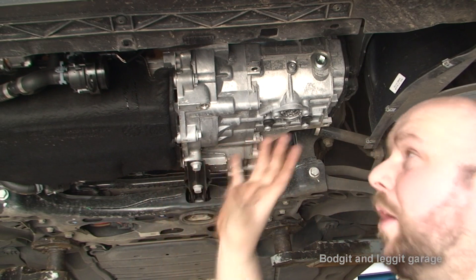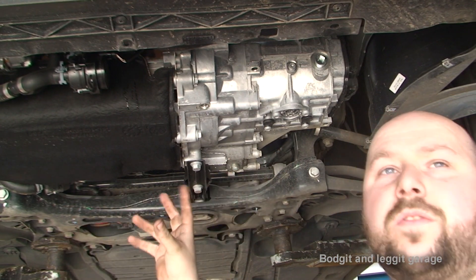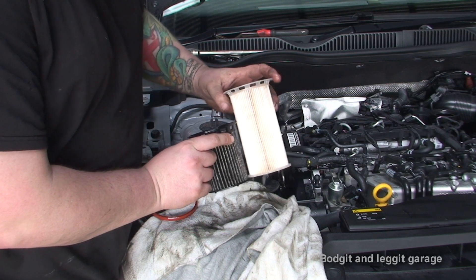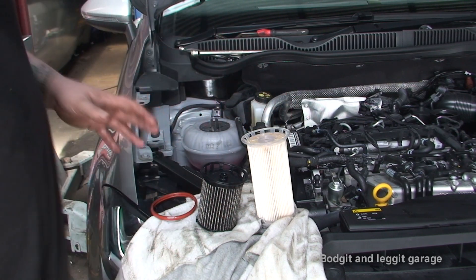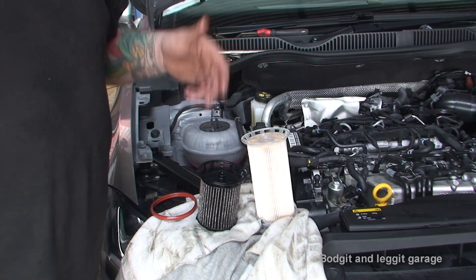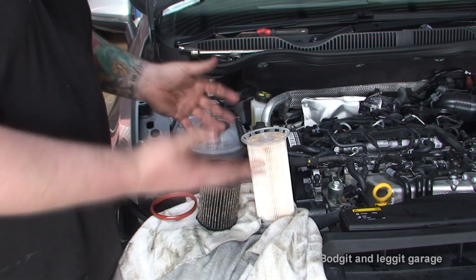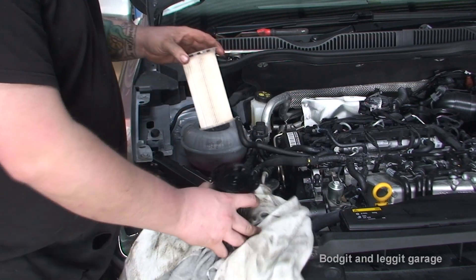It's always a good thing — I'm not going to put the cover on. I'm going to start it to make sure it's not leaking oil out of the filter or out of the sump plug. Don't put the cover on until you've started it, left it for at least five minutes, and checked everything. Now we've got a slight problem — well, a big problem really — with the diesel filter. We've cross-referenced this with every type of filter and it's coming up with this filter, even though this different-sized one is what came out of the car. We even rang the main agents who supply the motor factors and they're coming up with this part. The only thing is the filter housing is huge, so I'm going to put this inside the filter housing first to see if it fits.